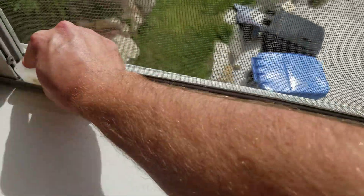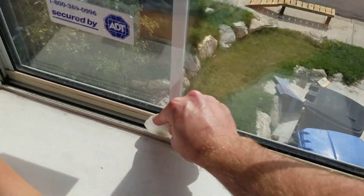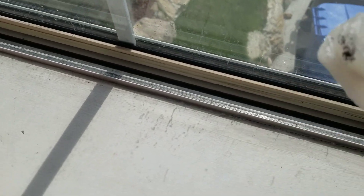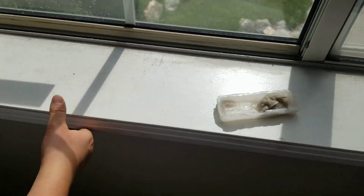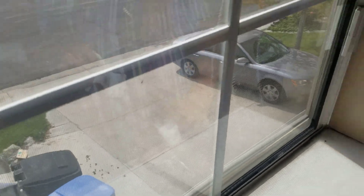Just a little bit of wax will make a big difference. So we'll rub that on here. Let's see how it works — got a little bit on that. Go ahead and slide that closed. And now let's rub it on there too, again, we're just rubbing it on this little metal shelf here. I'm not rubbing it down below where it's already nice and slick, but rubbing it up here where there's a metal-on-metal contact. Let's see if that did the trick. Go ahead and try to open it again. It sounds better. It moves better — oh yeah, that's sliding a lot easier.